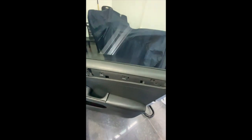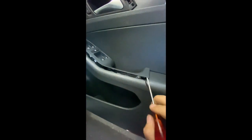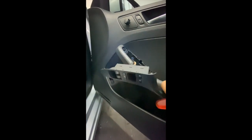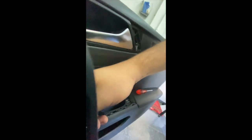Your next step is to go to your window switches. It's going to be on pretty tight — you just have to pry it up from the bottom, up in the center and the front, and this should just come right out. Then you should just unplug the wire over here, which is done by pushing this orange clip back, and it should just snap out.